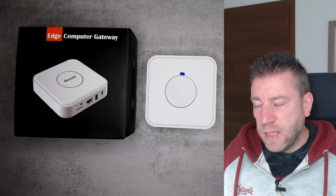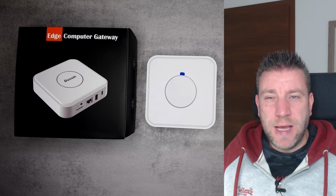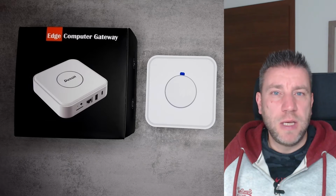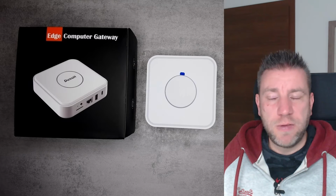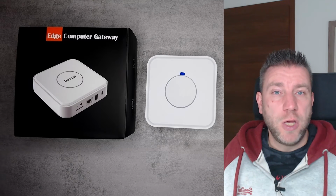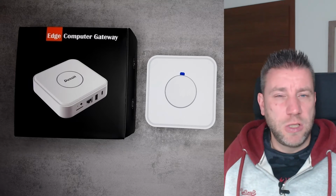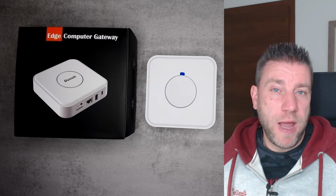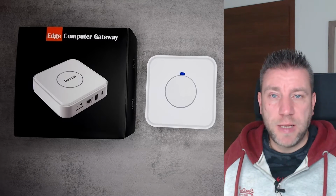So I was thinking that maybe I should do something local, and then I was thinking that at my home, I already use Zigbee to MQTT, and that's working fine. Zigbee to MQTT knows all the devices, and I also found out that TapHome can talk to MQTT. So, why would I use a cloud solution? I can just do everything locally. I could use the same route as what I have at home. I have a micro PC and it has a Zigbee dongle plugged into it.